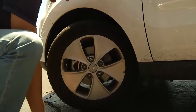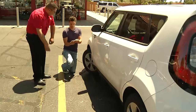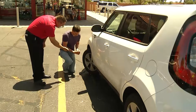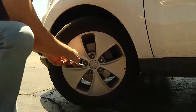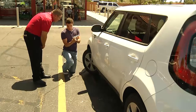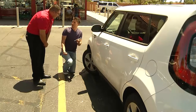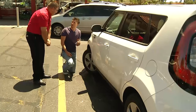So I'm just going to unscrew this cap here — it's kind of like a bicycle. You just stick this part onto the little valve stem here, put your thumb kind of behind it and just press, then come back. So this looks like 38 PSI. And you say that's good — in the summer heat, your pressure is going to rise a little bit as it gets hot.